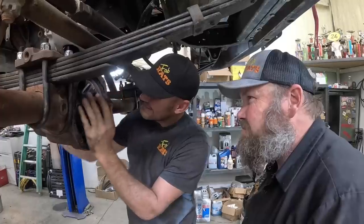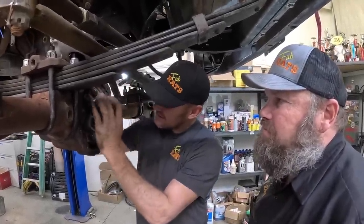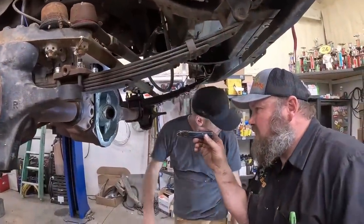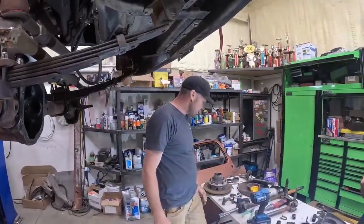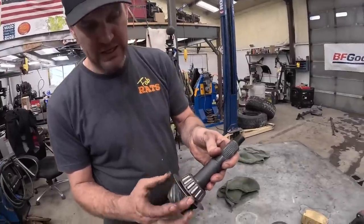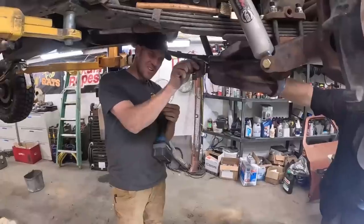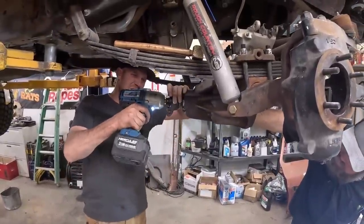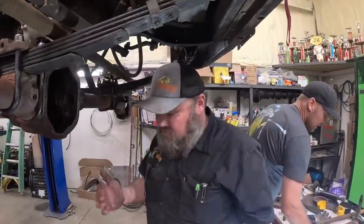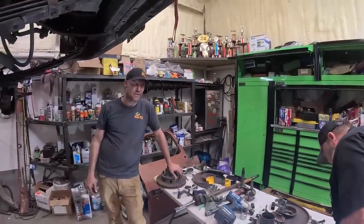No backlash. Zero. Is that a good or bad thing? That's a bad thing. We need a little bit. Washer's bent or something. That just isn't right. No, it's gotta be tight. Yep. And if it was tight, it'd pull that in and give you backlash. This is what we got going. For some reason, the bearing did not go all the way down, so we gotta make it now. All right. Just maybe. That's about perfect. Hey, and that's still tight. Perfect. Did something right. Slip that in there and see if that has backlash now, or if we're changing those.